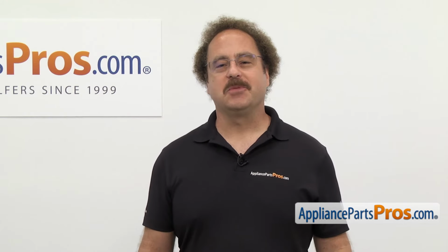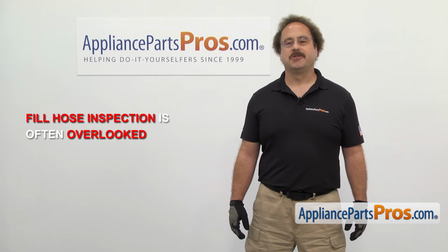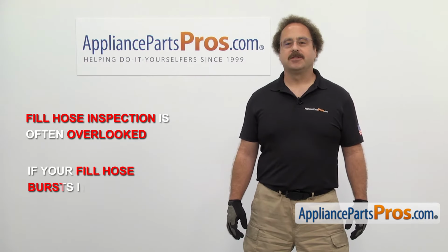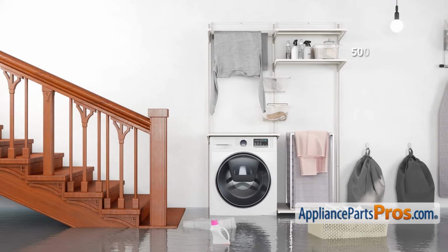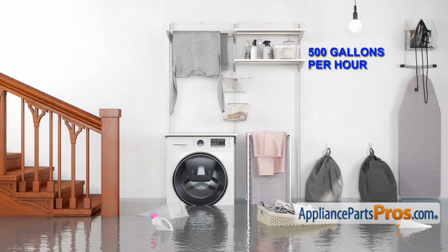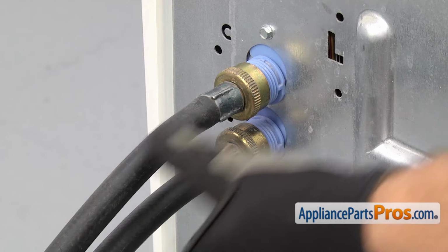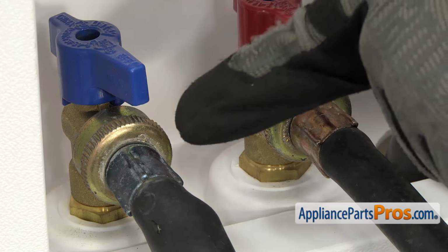Now here's that safety tip we promised you earlier. Washing machine fill hose inspection is often overlooked by most people. If your fill hose bursts, it can cause severe water damage to your home. A fill hose can flood your home with up to 500 gallons of water per hour, so it's important to inspect them regularly. Make sure to check the entire hose for any signs of bulging or leaking. Also make sure the fittings aren't corroded.